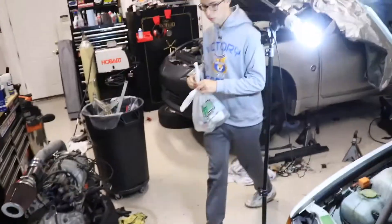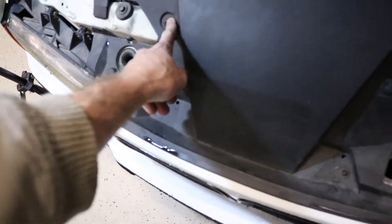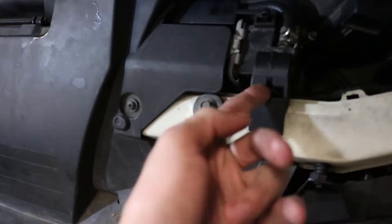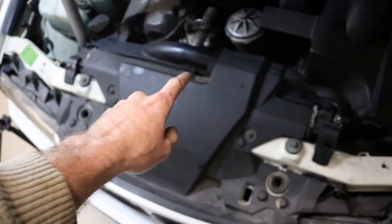It's about $190 or something like that. So what we're going to start doing is tearing apart all the old setup. You can go ahead and remove all these Phillips screws right here — the pretty apparent ones, I think there's four. Remove this air ducting, start popping off the radiator hoses and these clips. Get a screwdriver under here and kind of pry it back and forth and it'll pop out. Make sure you drain your coolant before you do this — there's a drain plug somewhere on this side or the other.